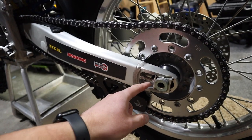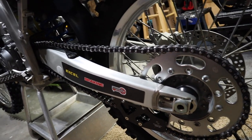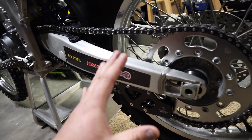One thing that should be done on every bike, new or used, when you pick it up: very first thing, take your rear axle out, pull your wheel, pull your chain adjusters, and anti-seize them immediately. That's the only fix — to do that now. Why that's not done at the factory is beyond me. I've seen new bikes one or two years old that have had seized chain adjuster bolts, and you don't have a choice — you've got to drill them out, or you break a bolt off and use the method I'm using. Obviously drilling them out is a very last resort, but you got to do what you got to do. It's a fairly easy process anyway.